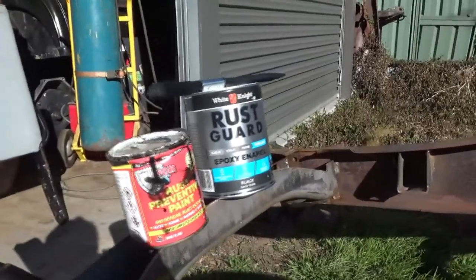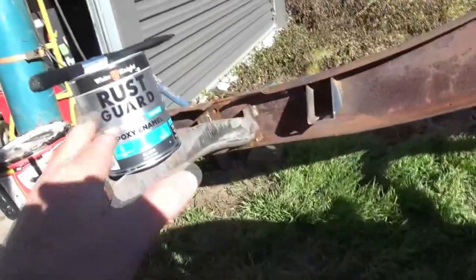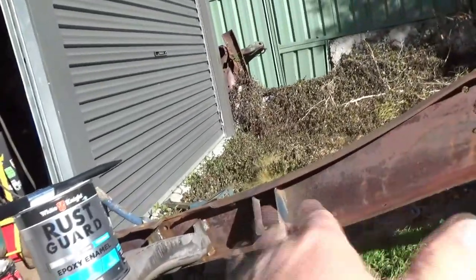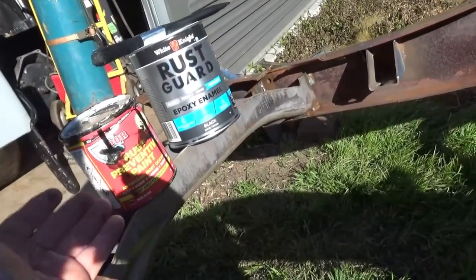I'm using two different types of paint. I'm using POR-15 for the inside of the chassis where it's the rustiest — that's what it's designed for. For the outside, where I've sanded most of the rust off, I'm using Rust-Guard in a satin finish. POR-15 gloss on the insides — it's gonna look pretty good. Using a brush goes a lot further, and with this slow-drying enamel or epoxy it dries really slow, so you can brush it on and it still dries flat. I find I get a better finish, a better quality coat, and I use less paint. Hot tip: throw on some gloves, because this stuff ain't coming off your hands for a good week at least — trust me.